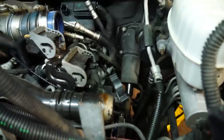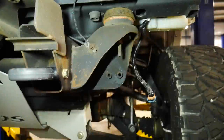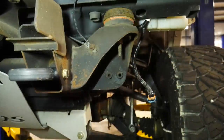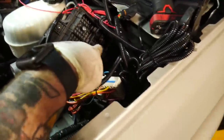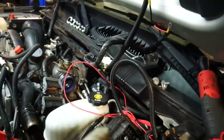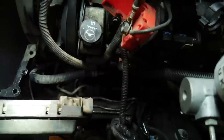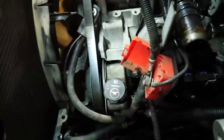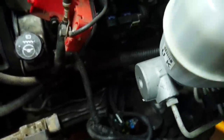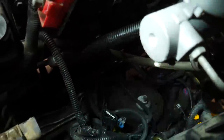Hot side pipe is off, so that means we took out our inner fender on this side. Now we'll kind of go look down into that other side of the fender as well. There's a ground strap right behind where the bumper was at — one 10 millimeter bolt, we'll take that one out. We unbolted all of the connectors from underneath there and started unhooking all of the wiring so that all of the harness wiring that came across the engine and hooked down into the bottom of the PDC ended up just falling down and sitting in our wheel well. Everything that goes to the PCM got unhooked there. The wiring that we had on our TCM, which was on our fan shroud, we unhooked that one as well. So now we've got all of the wiring on this side taken care of.